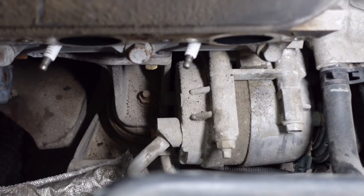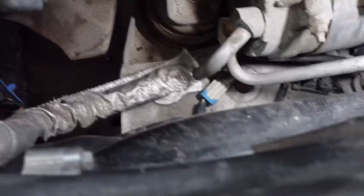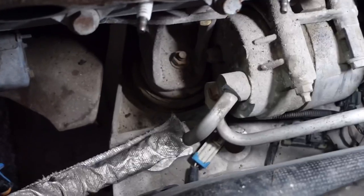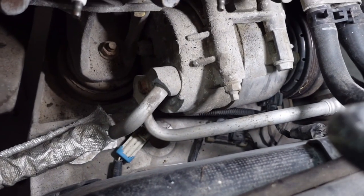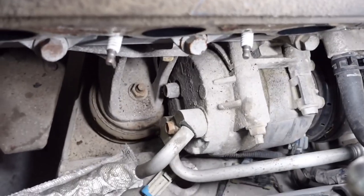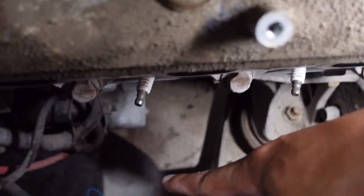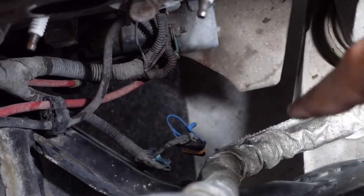Passenger side header is out. Now with the header out of the way there's plenty of room. Let's get this compressor out of there. The motor mount might be in our way, but it's not a big deal. We should be able to sneak it out the back way and then down through that little tunnel there.